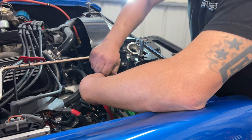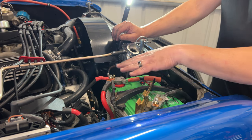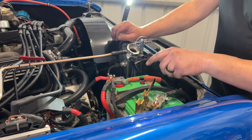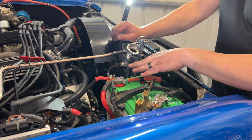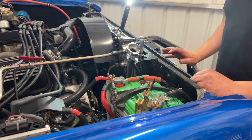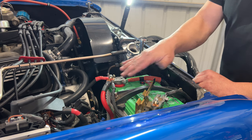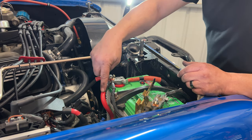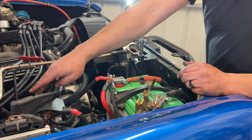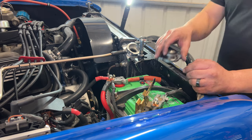And there is quite a bit of stuff still here, but I wanted to keep this because that's what Greg's familiar with. But there's a lot less stuff. So the only thing back on this battery is the winch, which I'm positive by the size of the cables that they wanted that back on the battery. And then the Holley, that's the only things. And then I've obviously got this going to the starter relay and all this other stuff that I built. So we have power there. Let's get this filled up with radiator fluid.